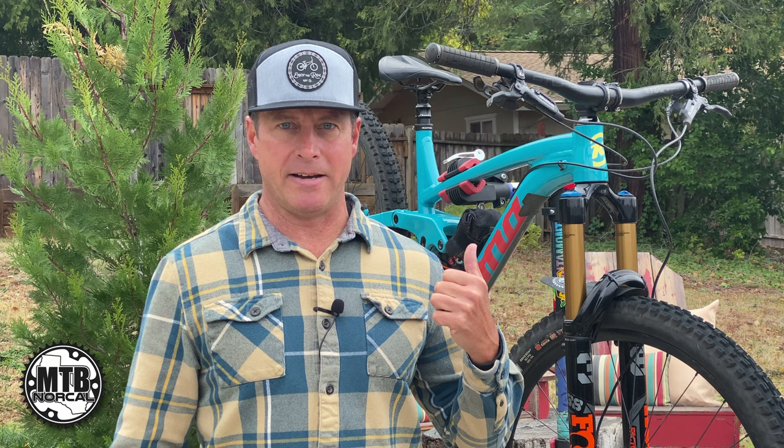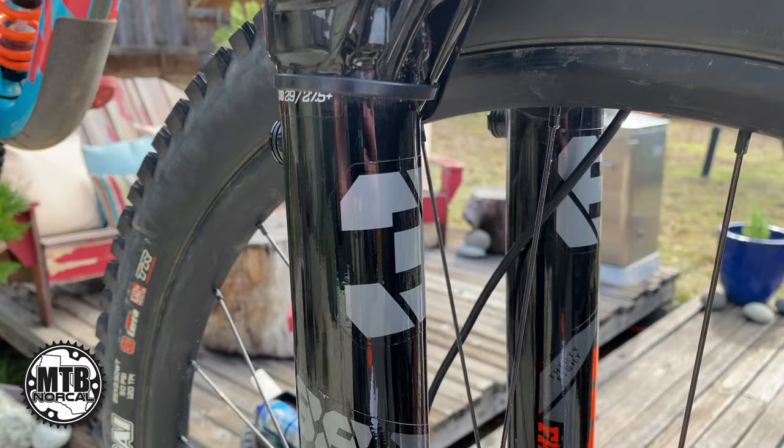If we're to put this on some sort of sliding scale: a bike that could make it down a downhill run, 140, 150 mil; a bike that still pedals well but smashes downhill runs, 160, 180 mil travel; and who cares about pedaling efficiency and riding trails, we just ride downhill, get yourself a downhill rig and call it a day. Starting with the Fox 38, why not a 36?